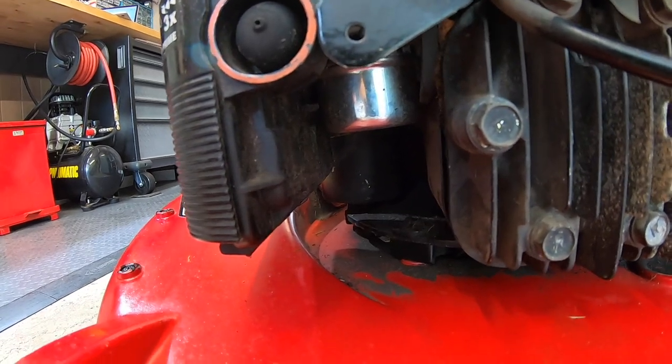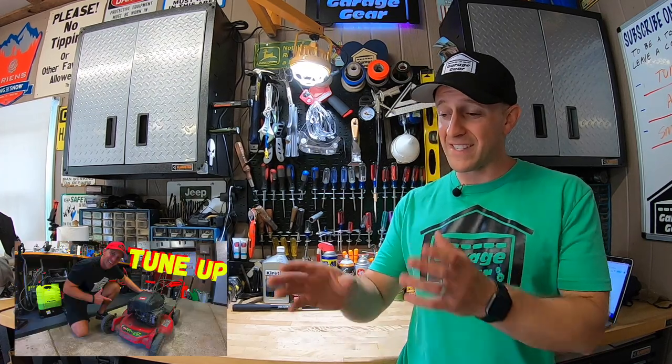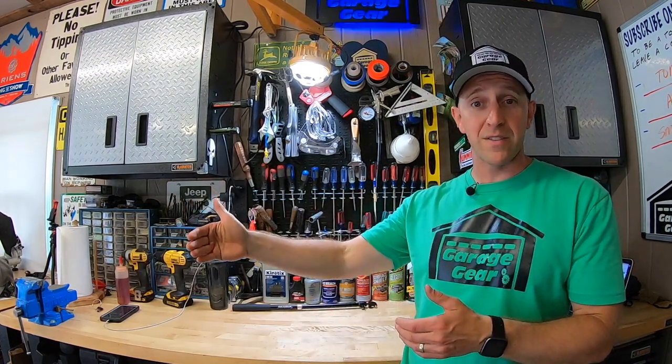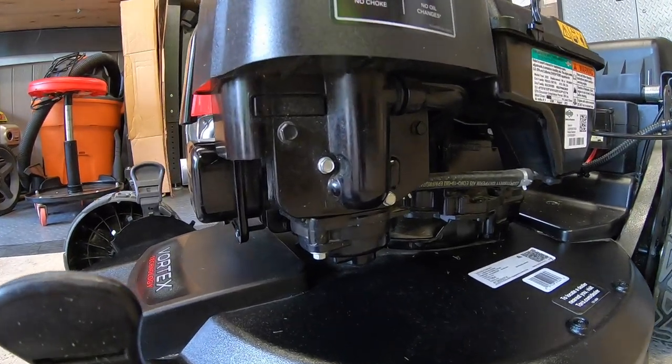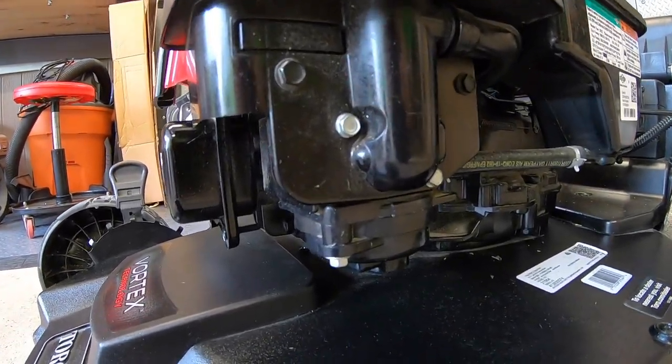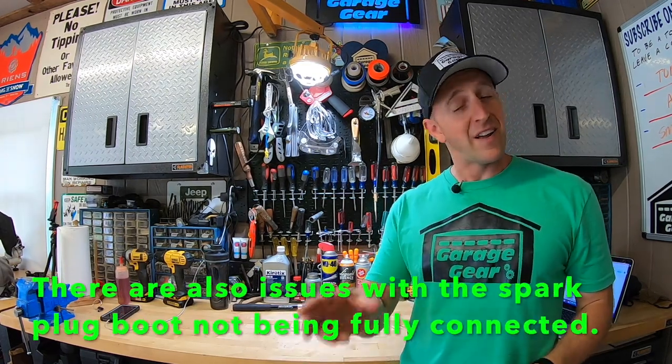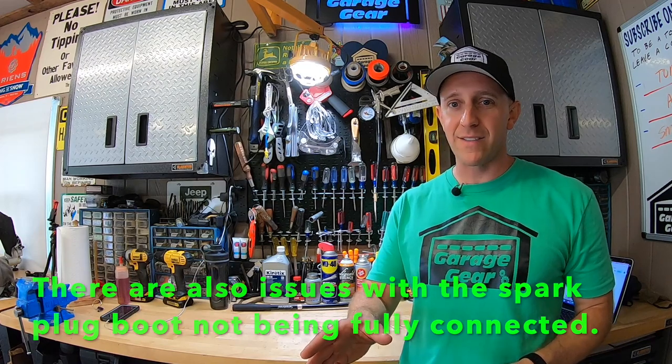The old style carburetors are metal — super easy to clean and maintain. I've tuned many of these up in the past. In fact, I did a tune-up video on this exact mower and I'll have that linked down below in the description. A little shot of carb cleaner and once they're clean, they'll run another 100,000 miles. The new Super Recycler carburetor is plastic. I've said this before — I'll take metal over plastic any day, and this plastic carburetor is riddled with problems. The engine likes to sputter and there's lots of videos on YouTube about this. I would seriously be concerned using carburetor cleaner on that.